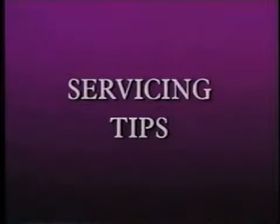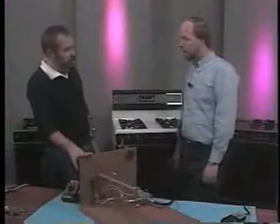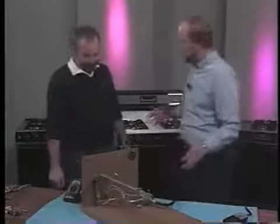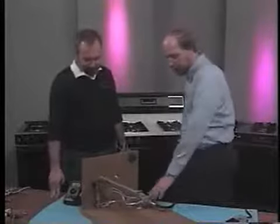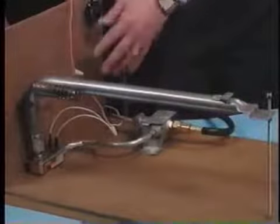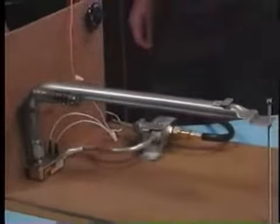Dave, I understand you built this thing. Yeah, it's the original wood stove, Frank. Now this simulates the whole oven burner system, where you have the regulator coming in off the tank, the thermostat, the glow bar, the burner, the oven gas valve, and then your gas fittings in between.